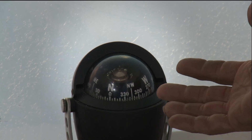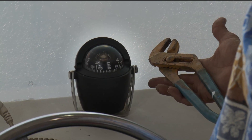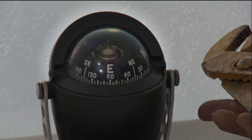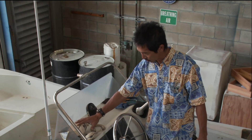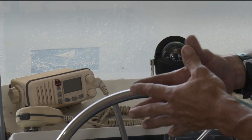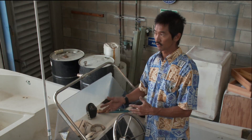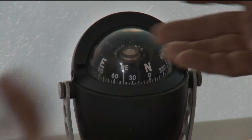This is a very simple compass, but all compasses are magnetic, so if you put something within range of the compass, you can very easily make the compass swing to an incorrect reading on the card, or an incorrect reading for the direction you're driving. So you need to pick a location on the dashboard that's highly visible, generally right in front of you, making sure it's square and straight. You need to be careful how close your electronics are to it, because it will cause the compass to swing, and a compass that swings will not read accurately. It could be something that has to be powered up or energized, and that may cause it to swing to a different number. So pick a good location and try to keep metals away from it.